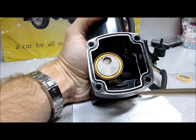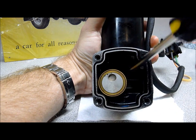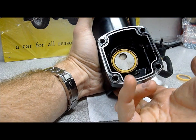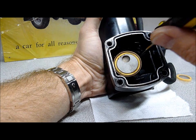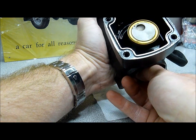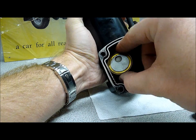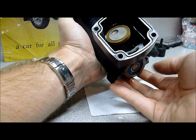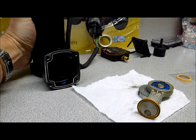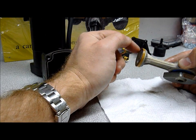We're going to remove this red gasket to make sure we don't damage it. Now we need to pry the cylinder off using a long flathead, working this piston and counterweight off until we can slide the piston out from the bottom. Now we have our assembly ready to work on. We're going to start working on removing this seal and replacing it next.